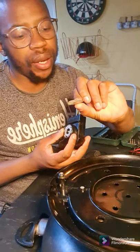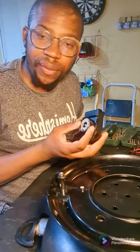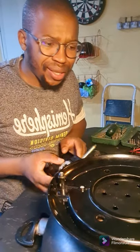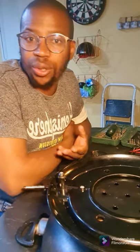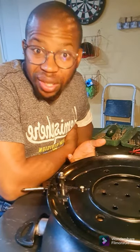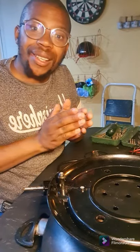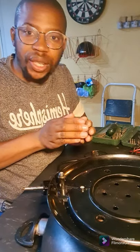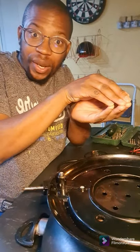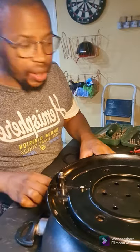The dial goes from zero to five, so it has a thermostat as well. Basically what a thermostat does is it opens and closes the circuit — it's like an automatic switch but works on temperature. I'll show you the inside of it and exactly how it works with its different plates expanding into different shapes. It's open when it's this way and closes again with heat.